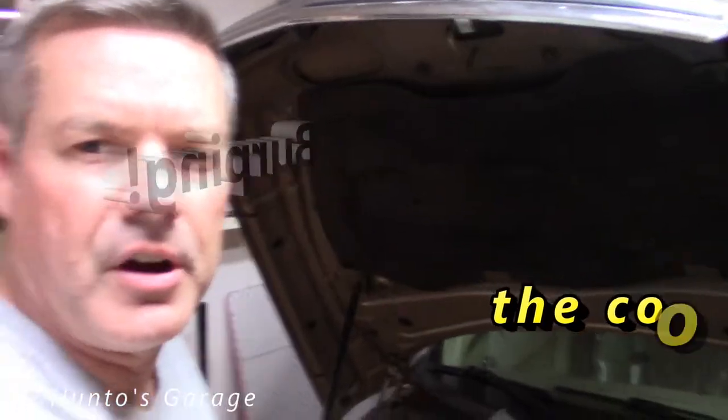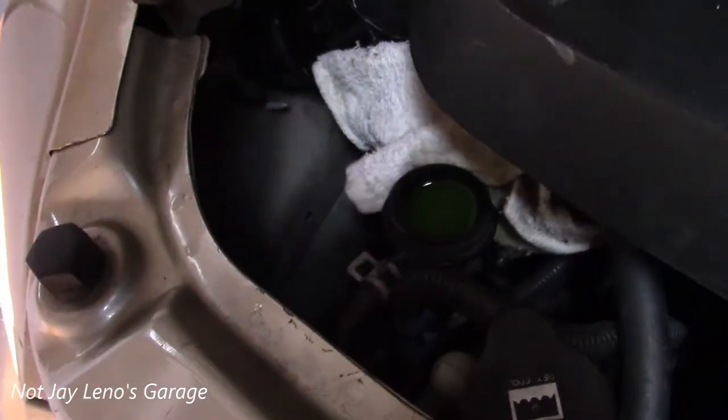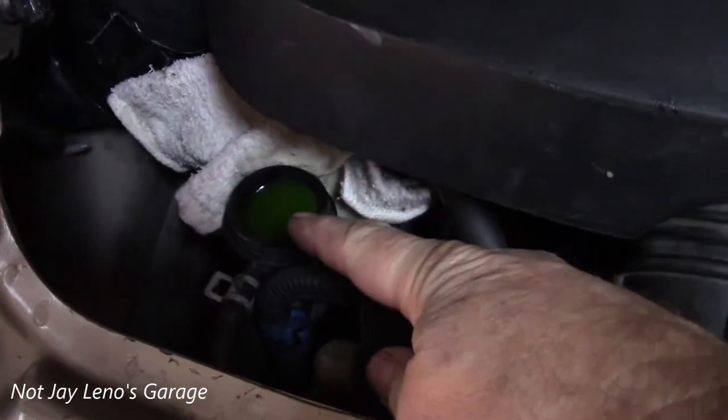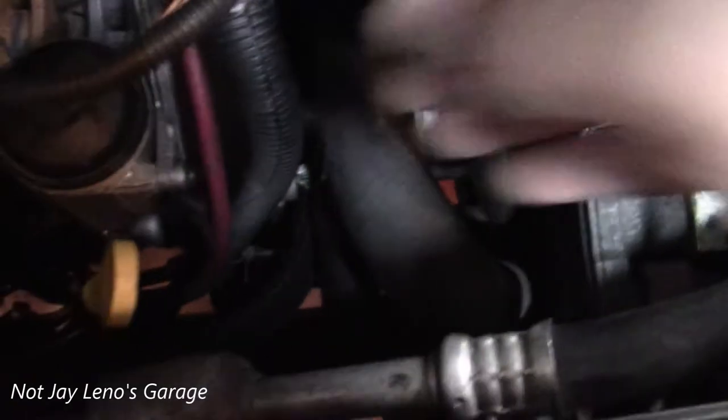For all you people with HHRs that have problems burping the coolant, here's something that'll help a little bit. You're watching for air bubbles coming out right here. What I'm doing is squeezing this big radiator hose down here — I'm just squeezing it and I'll watch over here.